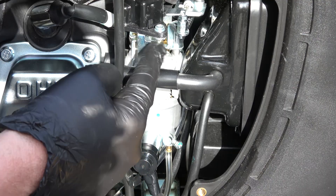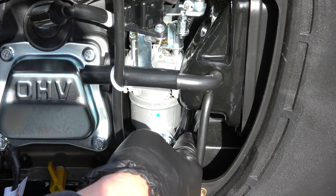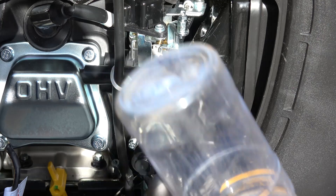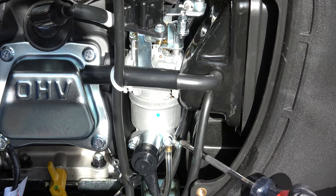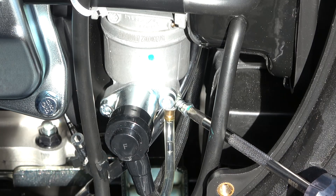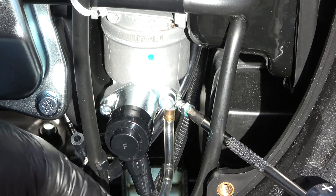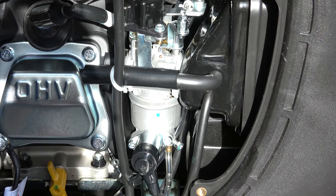Here's a close-up shot of the carburetor itself. This is the hose you're going to be looking for — it's on the right side of the carburetor and it just goes to the back of the unit. If you fish it out, you'll see that it's just an open tube. We're going to put a container to catch any fuel that comes out. We're going to use a Phillips number two, come in at a slight angle, and open that up. And there's a little bit of flow — not much there. So we did a pretty good job of burning up all the fuel.